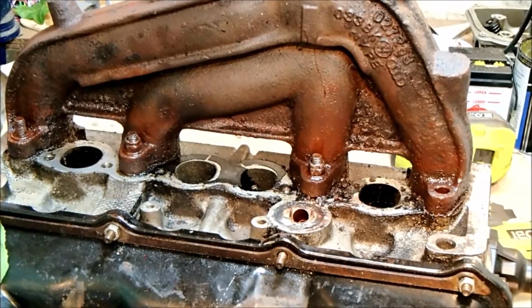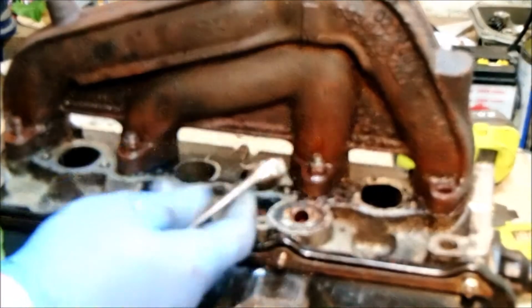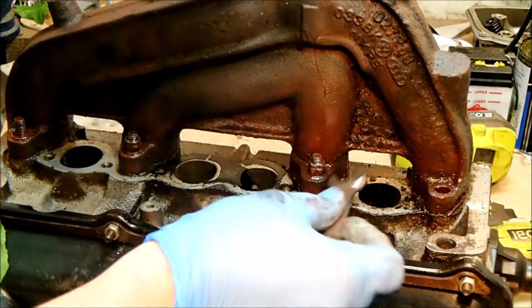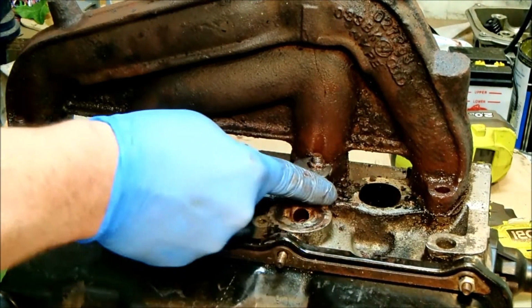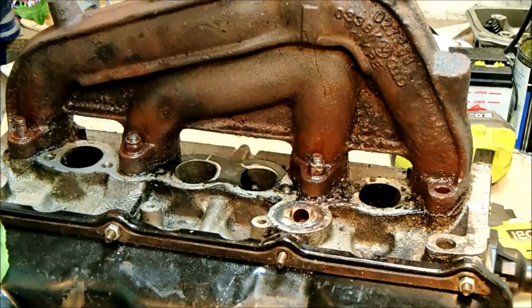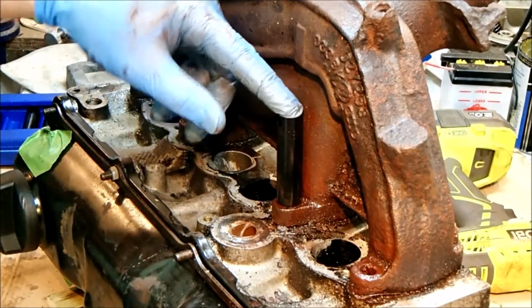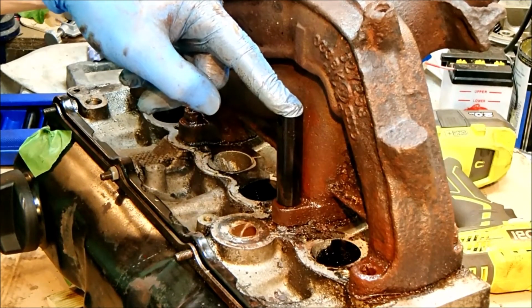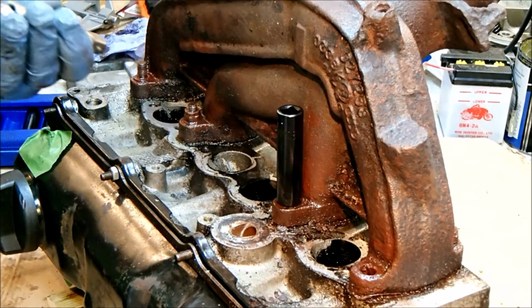We've definitely hit a problem nut here. Strangely, it doesn't look rounded, but it is rounded. I mean, we've got nothing there compared to the bigger ones. It's odd, there might still be some meat at the bottom of it, but I'm not entirely sure. I'm going to have a think about it and regroup. This attempt, I've hammered an 11mm impact socket onto the remains of the 12mm nut, and I really hope this works. So here goes, wish me luck.